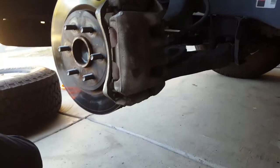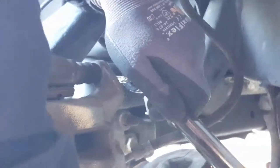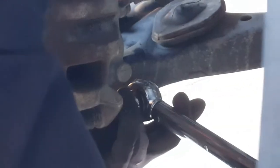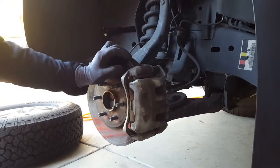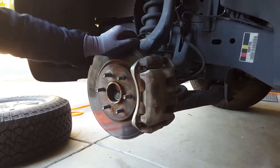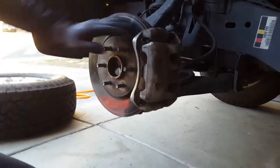Go in by one or two threads with your fingers first. Now we'll take a torque wrench and tighten it up — there we go, that's the final torque. You guys should confirm the torque spec with the Nissan dealer or just call them, they'll tell you what the torque setting is — that's very important. So that's it, we solved the problem with what was causing the scratches in my rotors.